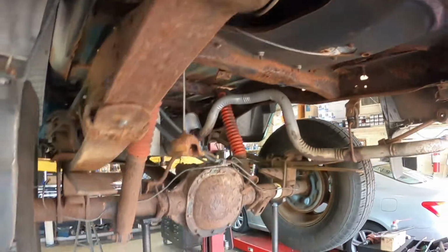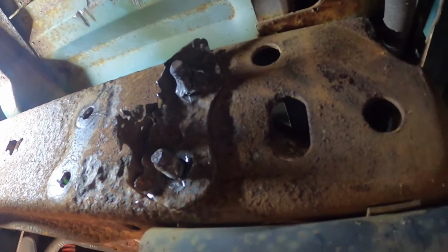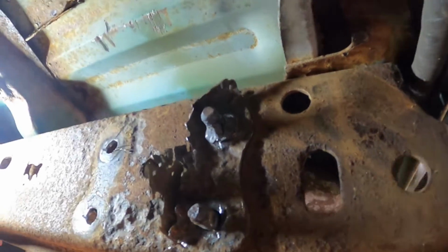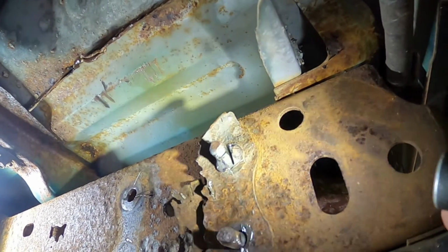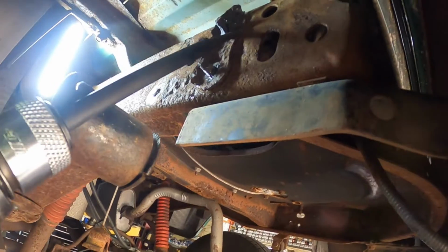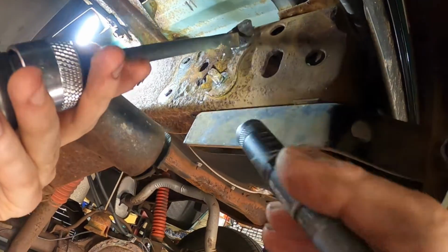All right, I'm going to change air hammers and try this other air hammer I have and see if it's any stronger. Okay, so we used the air chisel, knock those out, and then over here we're using the cut-off wheel to cut a groove in the nut, and now he's going to take the air hammer and just knock that off. Go ahead, get in there. Okay, hold on. Try to get the cutter in your hole that you just cut.